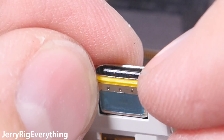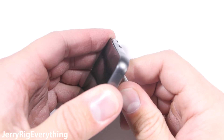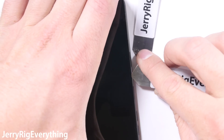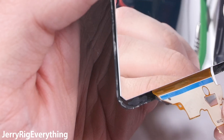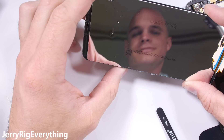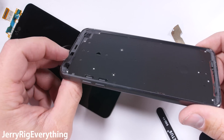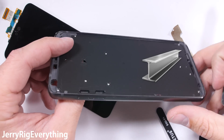The charging port has a yellow rubber ring around the tip that helps keep water outside of the phone. The front screen also has adhesive all around the edge. I was able to push up on the glass from underneath the frame to start a gap, and then slide my pry tool along the edge to cut through the adhesive. I noticed the corners of the LCD aren't actually corners — they are rounded. This is interesting because it eliminates one of the most fragile parts of the LCD: the corner. Hopefully this small change will help keep the LCD from cracking underneath the glass layer if it's ever dropped. It's also interesting to note that the metal frame is shaped like an I-beam — the same structural shape used to add strength to metal beams inside of skyscrapers.